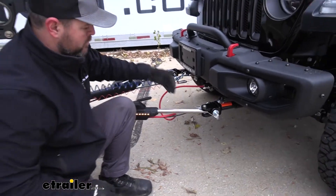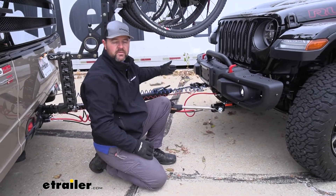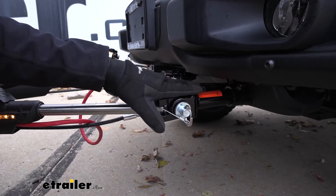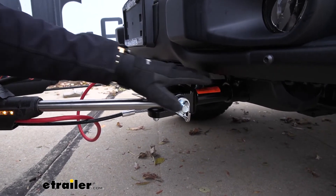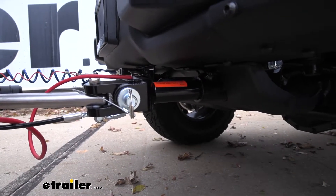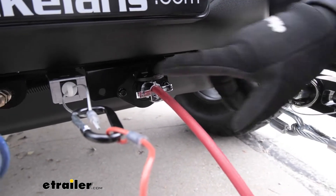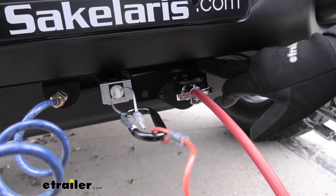Keep in mind, safety cables when hooking up to your RV need to criss-cross — your driver's side is going to hook to the passenger side, and your passenger's side hooks to the driver's side. The base plate is going to be a steel construction with a black powder coat finish, so it's really going to look nice and match this Jeep very well. It will help maintain a nice clean look for a very long time. The base plate is also going to come with integrated safety chain loops and your six-pole plug mounting bracket, or wiring mounting bracket.